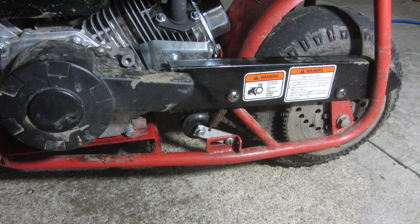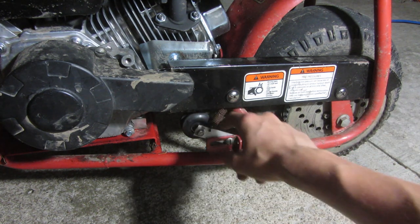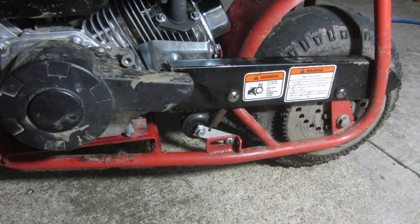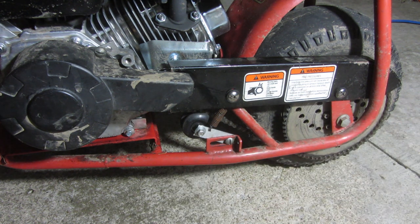So if you do like having the chain guard on, it will work. Even if you have the stock doodlebug it's probably worth upgrading to this just so you always have good chain tension. When you do this, line it up and cut your spacer to the correct length so it's perfectly centered on the chain — you don't want it to one side because then it could eat up your pulley. The bearings that came in the skateboard wheel are actually pretty good, so I didn't have to use any other bearings. Especially if you have the six and a half horse, I would definitely recommend doing this modification — it's pretty much free assuming you have some junk laying around.